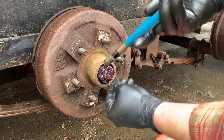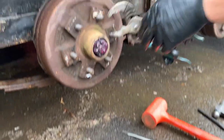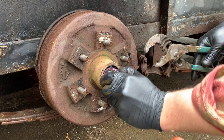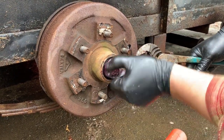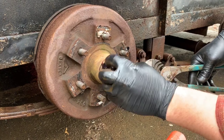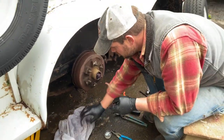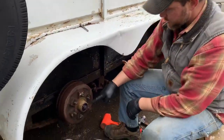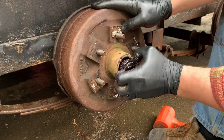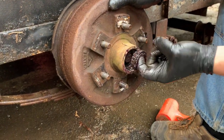Let's take this whole pin out, put it in the cap, and then we're just going to take the nut all the way out. There's a washer behind this, and because we're working outside I'm going to put all of this on a rag. Then I'll leave the washer in and just pull the whole hub off. There's your washer and the bearing.